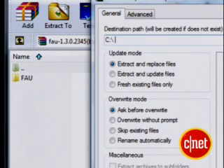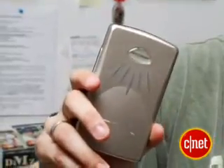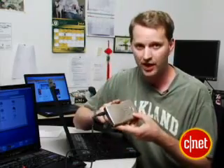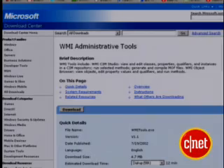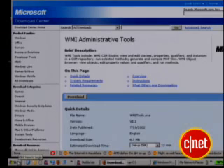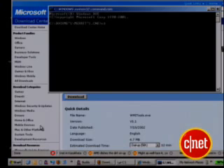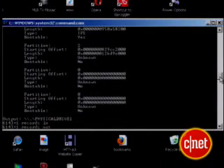I unpackaged the FAU files to the C drive right next to my disk image. I had a ThinkPad hard drive in this case, plugged into the Windows machine — the actual drive that will go into this machine. I'm going to take the image and bit by bit copy it using a program called dd.exe from the Forensic Acquisition Utilities and copy the image to this drive. To do that, I need to know the physical address of this drive, so I downloaded WMI Tools from Microsoft and used WMI Object Browser to determine that the drive was actually physical drive 1. Then I called up the command prompt and typed in the dd command with the name of my image file and the physical address of the destination drive. The drive then began copying the image to the external drive.